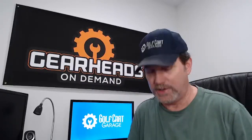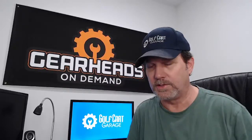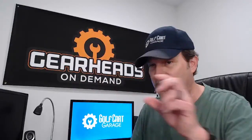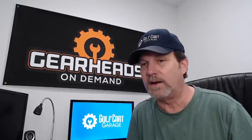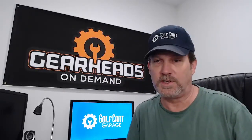What would be the correct tire pressure, Harris is asking? Well, for normal golf cart tires, the correct tire pressure is 22 PSI. Now, I don't know exactly what tires you have on your cart, if they're not normal. But all tires have it written on the side. It might be very small and hard to see, but there will be max PSI written on the side of the tire. But 22 PSI would be stock golf cart tire pressure.